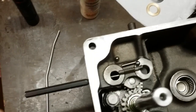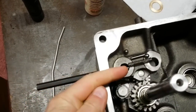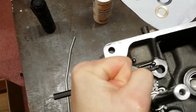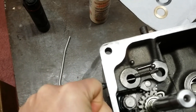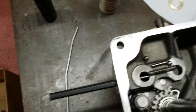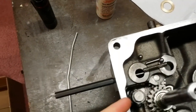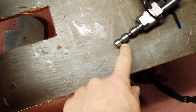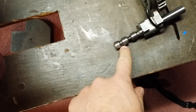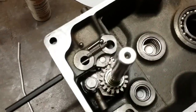And with one hand pushing this in, holding the detent ball and spring in the hole and pushing down on the shift fork, you got to make a quick one-shot motion. Push down and pull out at the same time in order to get the shaft to go in at the same time pushing the ball bearing in, if you follow me. So that way the ball bearing rides up and hits the first detent slot. This can take multiple times in order to get it straight.